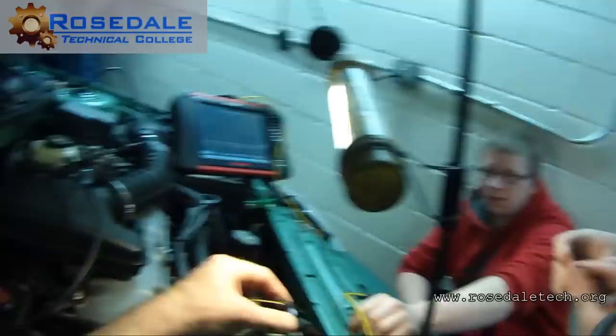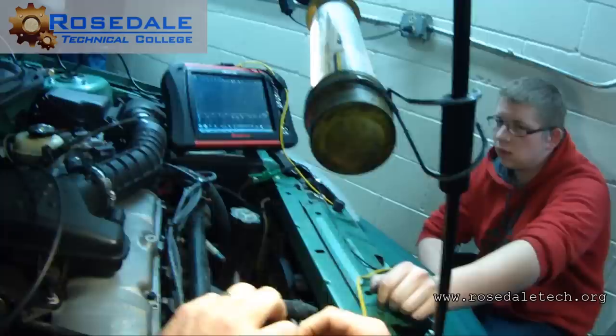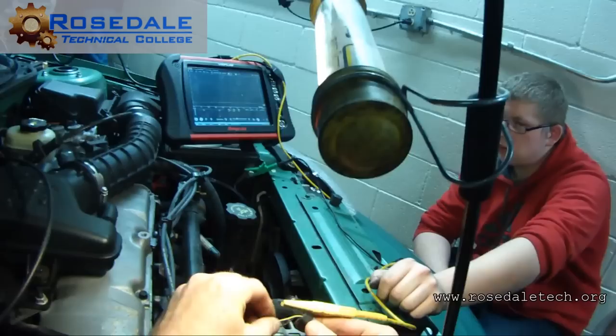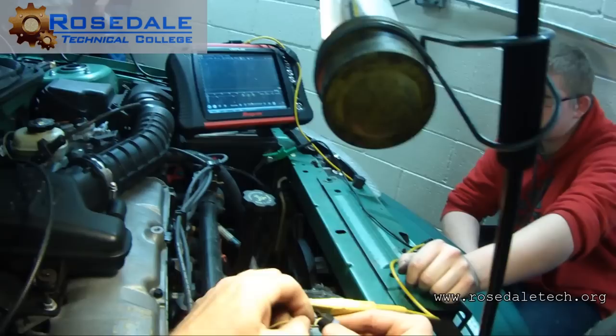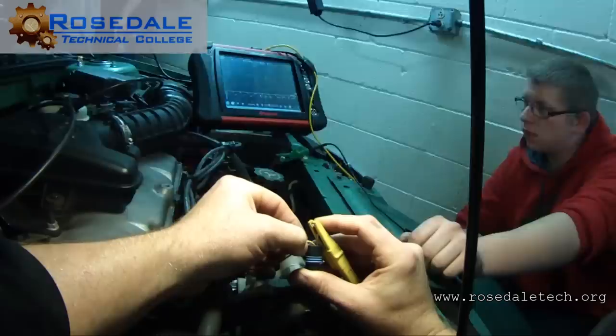We might want to get a different probe so we get better readings here. This should be 5, and it's not. We totally are missing our reference now, right? Yeah, we have nothing there. So this wire is broken. Where is this broken at? I believe you have a broken wire inside of this insulation. Right there. Is it at the pin? It is. I think you're right. Jim, look, I'm moving it right there. Oh, it's much better. That's actually better. Turn that off for a second.